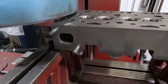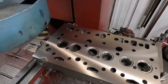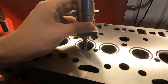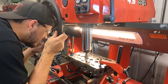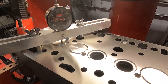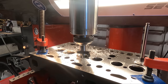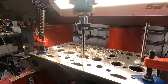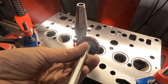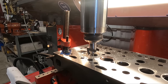We resurface the head on the surfacer as the last step before moving on to cutting all of the valve seats. Our specifications list the valve recession depth for both intake and exhaust valves — in this case our valves have a 35-degree facing. Starting with the intake valves, I cut my seat to what I think will be somewhat close to the finished depth, then set a valve on each seat and measure the depth. Those measurements are used in conjunction with the digital spindle depth readout on the Sunnen machine to take the seat down to the finished depth. Since I only have a single-angle cutter to make a 35-degree seat, we have to come back with a second cutter to narrow up the top side of the seat to our desired width, keeping the seat contact area within the outer edge of the valve face.